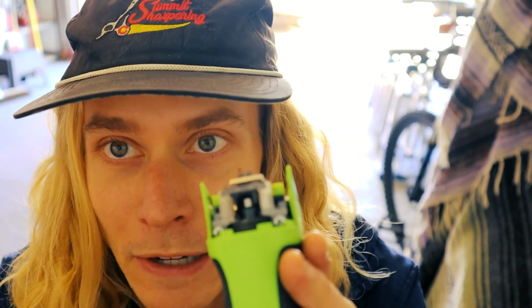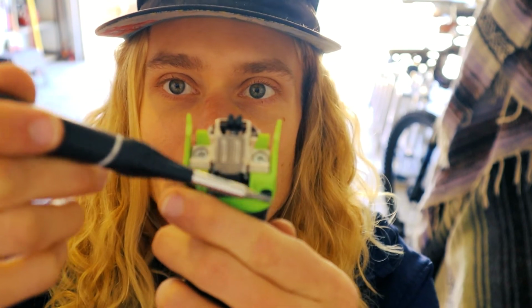So if your clippers are making a loud noise, first take the blade off, make sure it's not the blade, and then run them without the blade and make sure it's not the blade drive by snugging up the screws. If those two things are tight, good. Next, you want to snug up these 2 screws on the hinge. And if all that's snug and good, and it's still making noises without a blade on, it's probably something internal and you want to contact your professional repair guy.